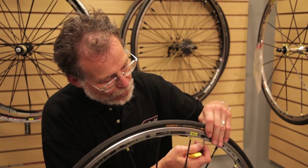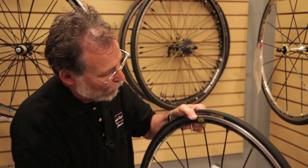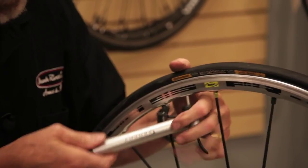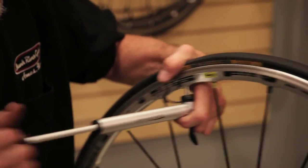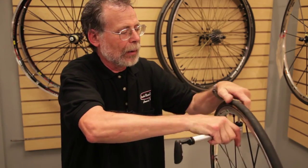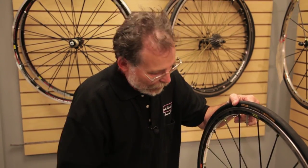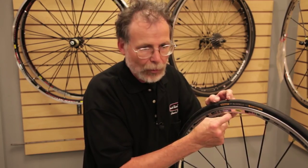I like looking at the tire all the way around, pinching and squeezing it to make sure the tire is molded carefully into the rim edge. Give the valve stem a little push to push it up into the tire body. Use your favorite inflation tool, put the pump onto the tire valve — this one has a locking valve stem with a T-handle. Wrap one thumb around the tire, hang onto the pump head, and inflate — that's enough to ride on. Close the lock nut for a Presta valve; Schrader valves have a self-closing valve. Make sure you reinstall the lock nut — not necessary, but it's nice.